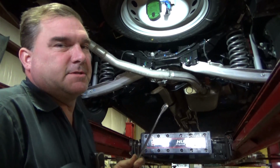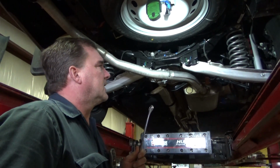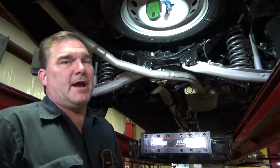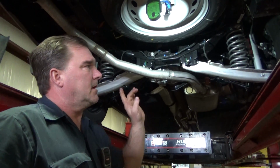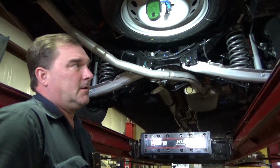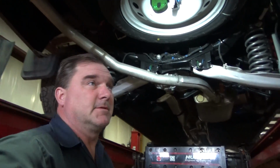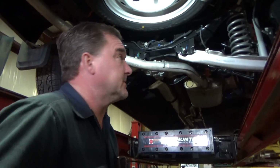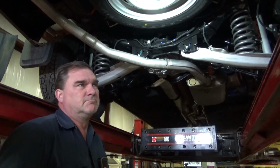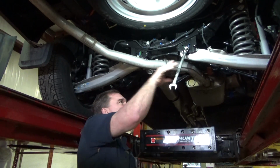Alright, so the rear suspension on the 2022 Maverick, at least on this one, these are your toe adjustments. There is no factory camber adjustment in the rear. I'm sure somebody will be coming out with an upper control arm that is adjustable if there's actually a demand for it, because that's usually what happens, people want it and then somebody builds it. But an upper arm that's adjustable will fill that void if that becomes a void.